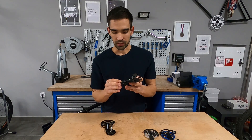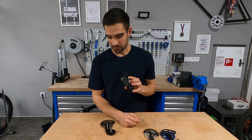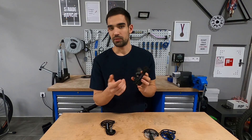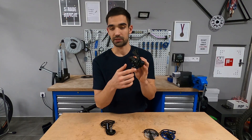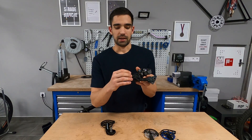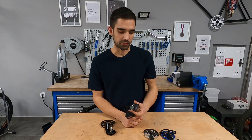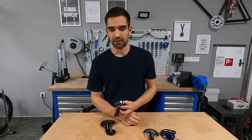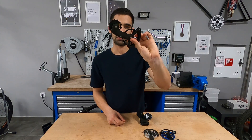You can remove the grease from the bearings to help with friction. But I'm also often asked why manufacturers don't spec larger pulley wheels as standard. A couple of reasons: firstly, cost — in nearly every single rear derailleur, pulley wheels are made out of plastic, which means limited stiffness and precision in manufacturing, and you only get precise shifting with a small diameter. Although the latest SRAM and Shimano mountain bike rear mechs have increased pulley size significantly to around 13–15 tooth.